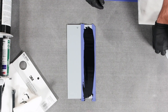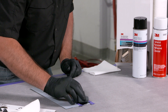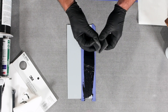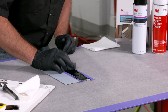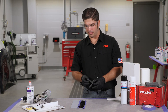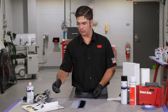Once I've got it straightened out, I'm going to take one of our gray Scotch-Brite pads, cut it down to a smaller size, and then just dab it over the surface while we're still in the working window. If you feel like you've got too much on there, you can also flip it inside out and keep working while the material is still wet. We're just adding texture into that surface. For this particular bead it's got that tape look — like somebody applied it off a roll of tape — with that awkward texture. This is what we're going for.